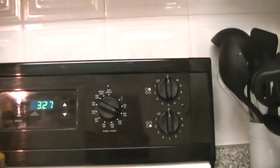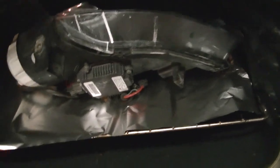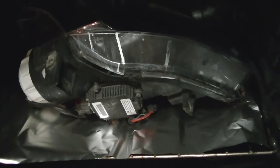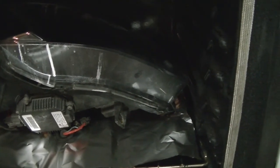It's in the oven baking right now at about 200 degrees Fahrenheit. A lot of people have different ways of doing their headlights — a lot of guys say put wet towels in there, but I don't want to do that because the towel could easily dry out and catch fire, which is a safety hazard. I use foil paper, put it on the lowest level, and use the foil paper to block anything from falling onto the heat element. At 200 degrees it won't melt anything on the headlight — all it does is soften the glue that's keeping the headlight glass sealed to the housing. So don't panic, you don't have to be scared about how you're gonna do it.